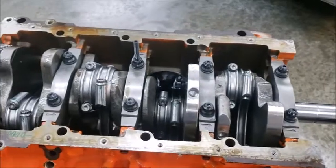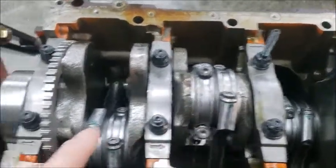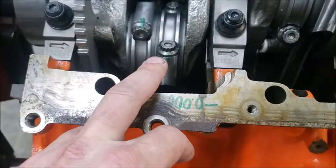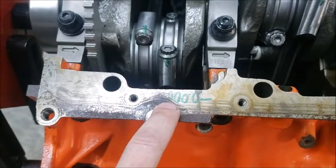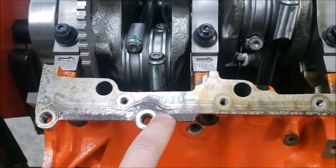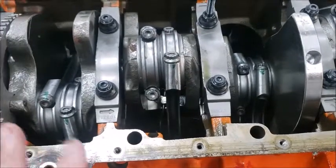All right, so there it is. These have all been torqued, all been stretched. It's a little hard to have them all, but always mark them. As you do them, mark them. I can't emphasize that enough, so that way you know. If you took the time to mark it, you know it's right. Also, leave yourself little notes. Like this bolt right here, when I was doing this on the gauge, this one was 5 thousandths over the 6. So then I brought down the torque a little bit more, and that's how I got the 87. And then I did these here at 87, and they all came out right on track too. So it worked out good.